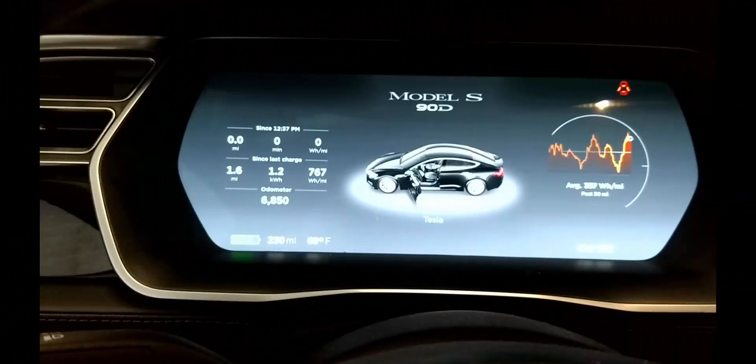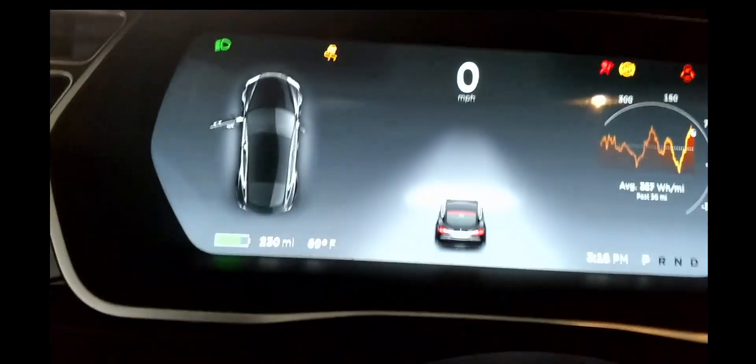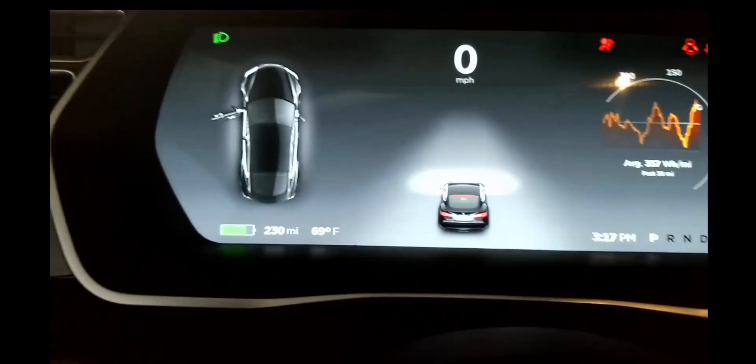Now, in the car, the instrument panel is activated by unlocking, and we will need to place the key fob in a spot that the car can recognize. The manual calls for using the cup holder, but then stepping on the brake — which is a signal to the car that it will be shifted into gear — results in the message 'key not inside' being displayed. We then went straight to the spot near the 12-volt power source near the bottom of the console. Almost immediately, the 'key not inside' message disappears. Don't bother with the cup holder.